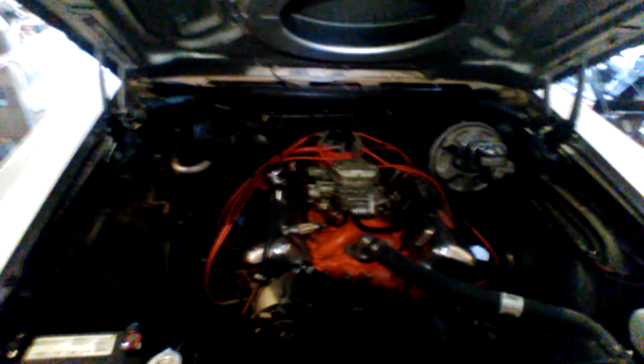The brake lights were on because I had a little snow scraper wedged in there to test them out. The pedal sits in just the right position. We had to go ahead and reconfigure the pedal underneath the dashboard because now that we're running power brakes, the manual setup was different. We got the pedal in the right position. The power booster is installed, everything's the way it should be. Master cylinder is installed, the lines are hooked up here and in the back, as you saw in the previous video.